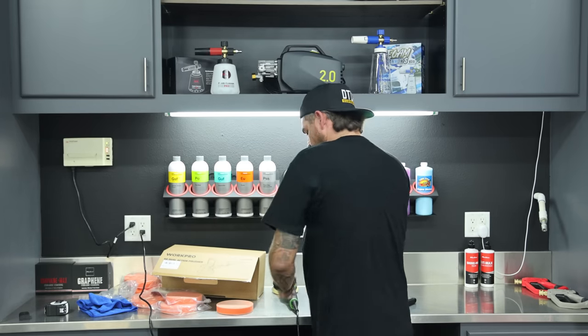I tested the rotation on curved panels to see if it bogs down or just starts shaking. Running at speed three on my fender, it was bogging down a little. At full speed six, no bogging at all. This machine maxes out at 5,500 RPM — though technically as a dual action it should be listed as OPM (oscillations per minute). On that curved section at speed six it worked well. As for the Shine Max polish from Maxshine, there didn't seem to be any dusting on the white panel, and when I went to buff it off, it came right off and felt really, really good.